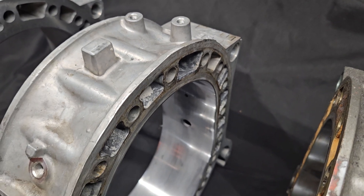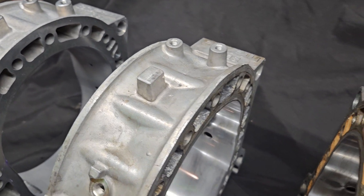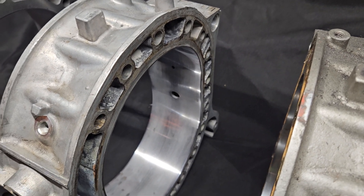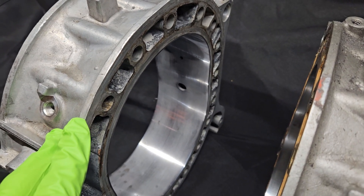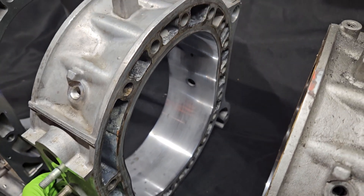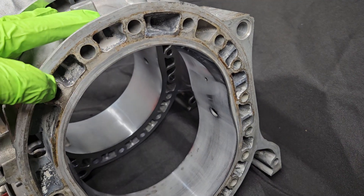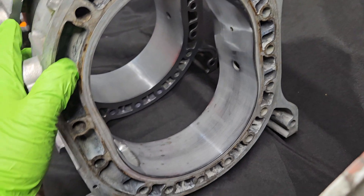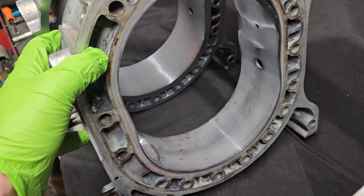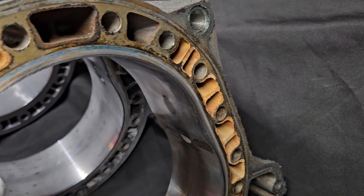At KMR and Mazda Tricks, for reliability or OEM builds, new rotor housings and lapped sides were the way we went to ensure the longest potential run time and best reliability without going to all new parts. If you don't have those options, then using used is an option provided you don't have any shrinkage beyond three thousandths of an inch in total in any given area, and provided you don't have any water corrosion that's started to damage the water seal area. You've got to make sure that the water gallery hasn't started to move its way towards the water seals — anywhere the water seal gallery might rupture to the water seal would be a fail point, and then the housing would be useless.